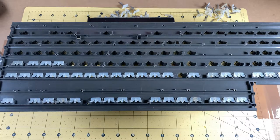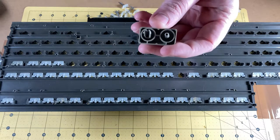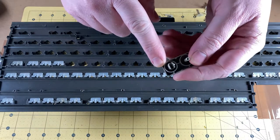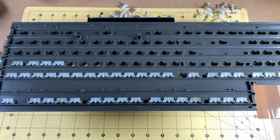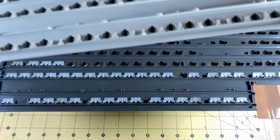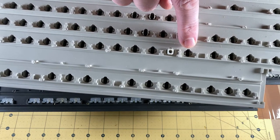Take a look at this key — this is the backspace key. On the bottom of this key we've only actually got one spring. It basically takes up two spaces on the keyboard, but it's only actually this part which has a spring in it. The other side has one of these spacers in it. The best way to show this is on the donor keyboard, because that still has its keys attached. Here is exactly the same donor board and we can see that little spacer sticking through there — only this side needs to hit the contact on the membrane.